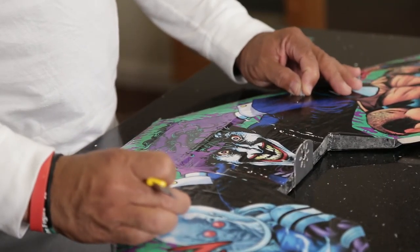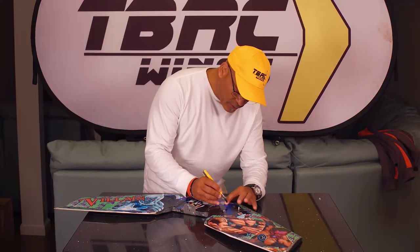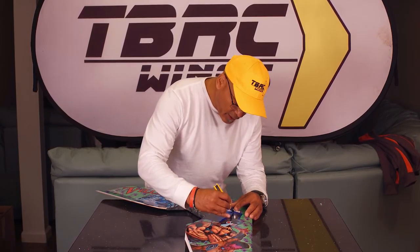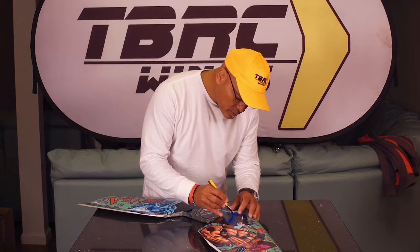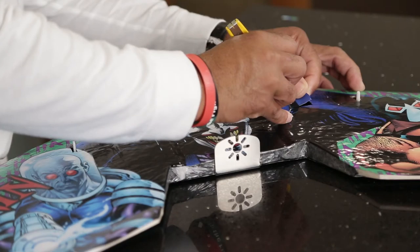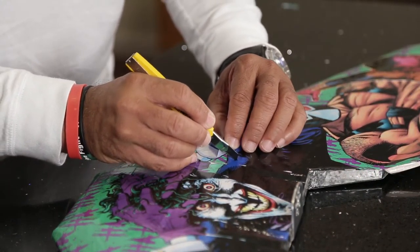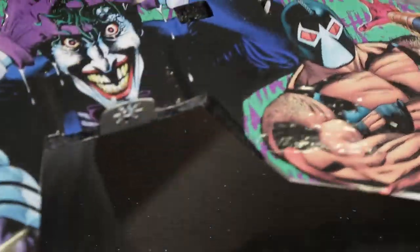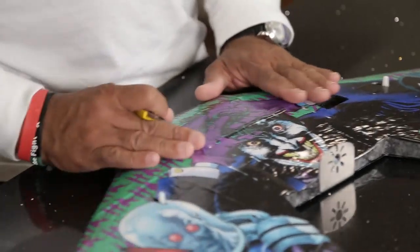Now we're going to cut out for our VTX which is right in here. I'm just going to try to find the edge of it — it's not going to be super easy but once you make that first cut you'll be able to walk it around and feel where the end of your pocket is. Then you can lift an edge and find things that way. There's our pocket for VTX — we'll drop that in and once we cut the hatch we'll be able to drop our wires in as well. It'll be nice and clean.